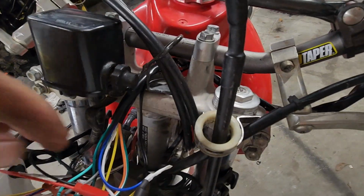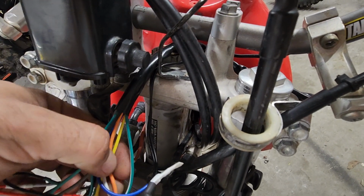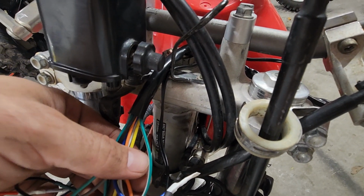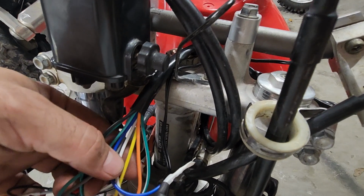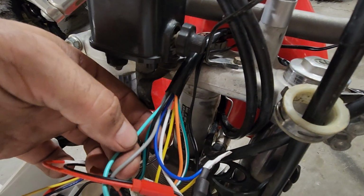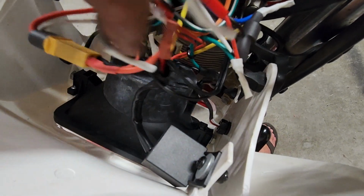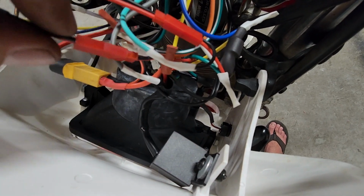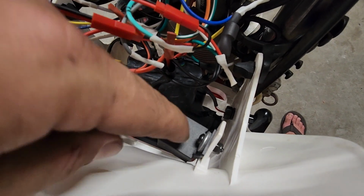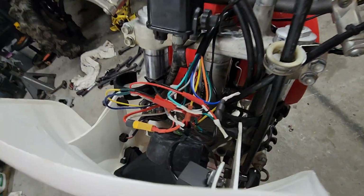Okay, turn signals. This green-white is your right turn signal out of the switch. This orange is your left turn signal out of the switch. And the gray right here is your power into the switch for the turn signals. So this gray has to go to your blinker relay, right? Which gets power from your battery. That's a really cool blinker relay. It's very waterproof, it's very cheap, and it works with LED blinkers that are very low draw. So link in the description, of course.